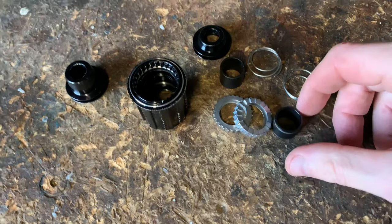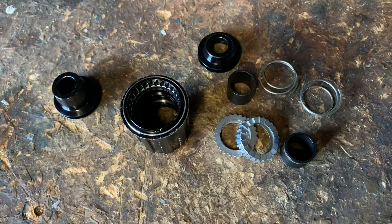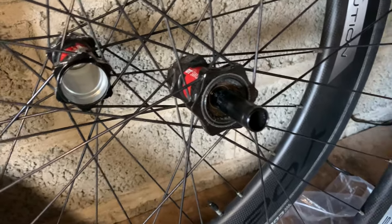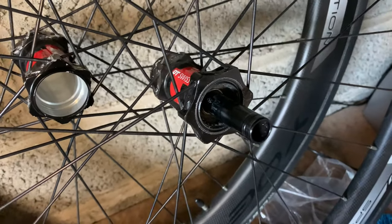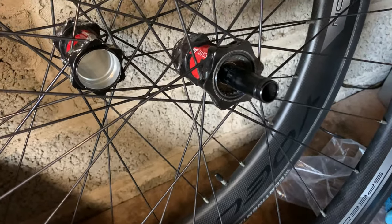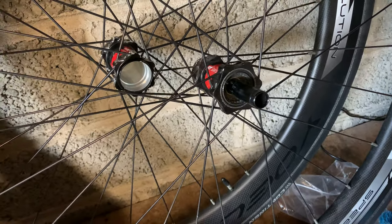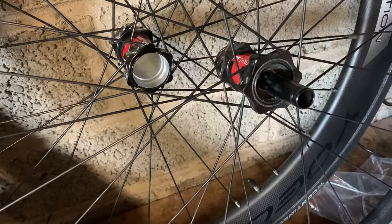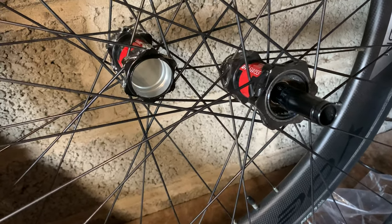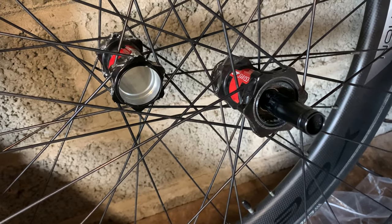I still can't get the rear wheel bearing out. What I'm going to do tomorrow is take this into work and use the 50-ton manual hydraulic press to press out those bearings. Then I'm going to return the wrong bearings and bearing presses back to Hambini, get them changed over, and when it all turns up I'll make the rest of this video. See you soon.